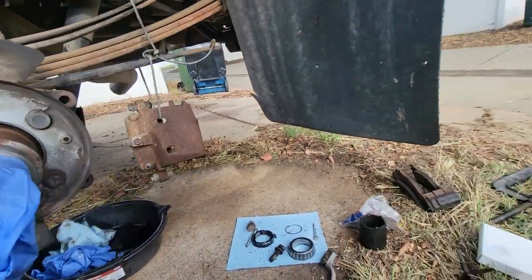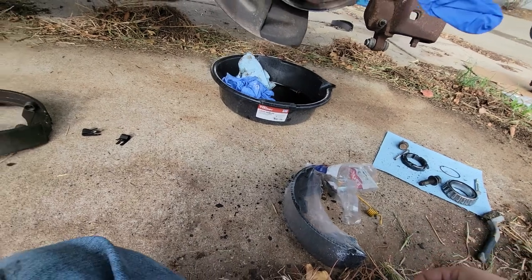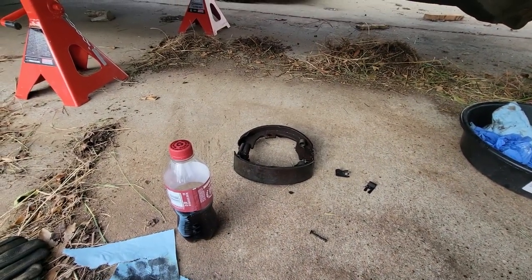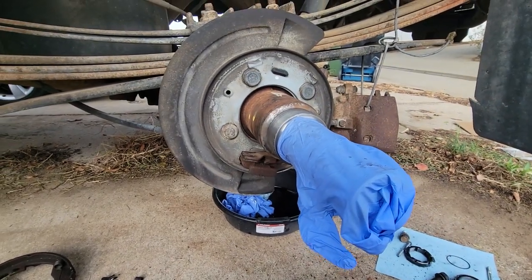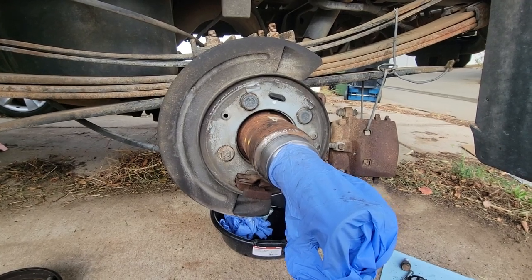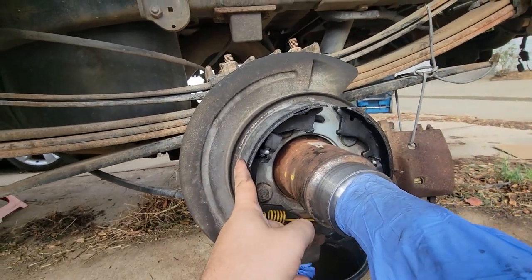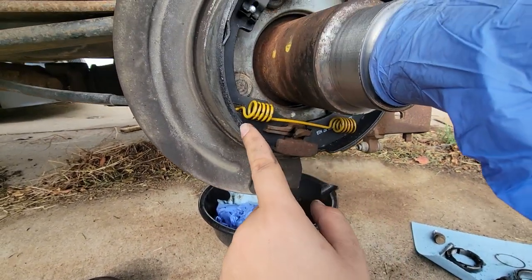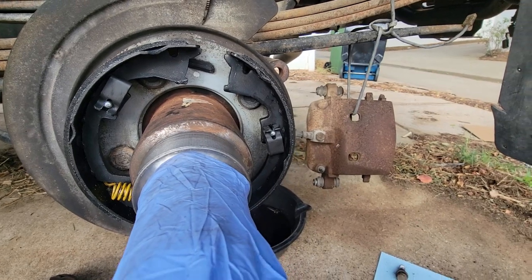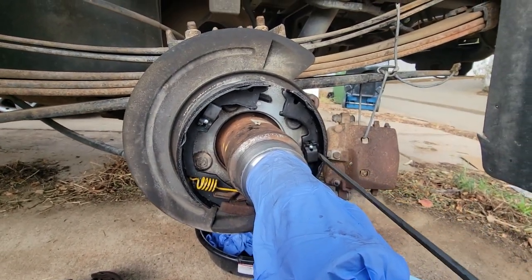We're going to put the new brake on. I got the new brake set right here with the kit. I'm not going to try to do a full tutorial on this because I'm not a professional, but I'm basically going to build it on the ground very similar to what I took off, then try to squeeze it on. Last time it was a pain in the rear. Got the brake shoe on first, put the clip in, put the spring on, used the brake to spread it apart, got it where it's supposed to go. In my OCD I kind of want to make all the clips face the same direction even though that probably doesn't matter.